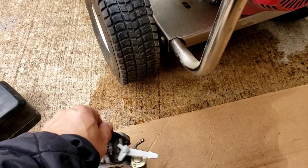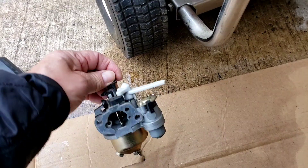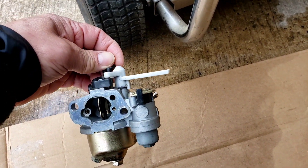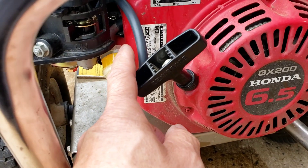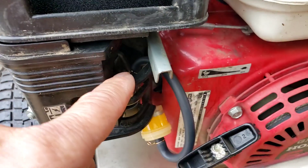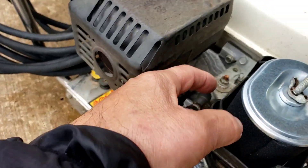I changed it all. The difference between the old one and this one — you see this little fuel inlet here, this pipe — it's actually facing straight up now. It was at like a two o'clock position, now it's pointing up almost at 12. Since it came with a filter and a hose, I redirected it: I took the original hose which comes out at three o'clock, made it go through the filter, up and over, and then into the inlet coming at 12.